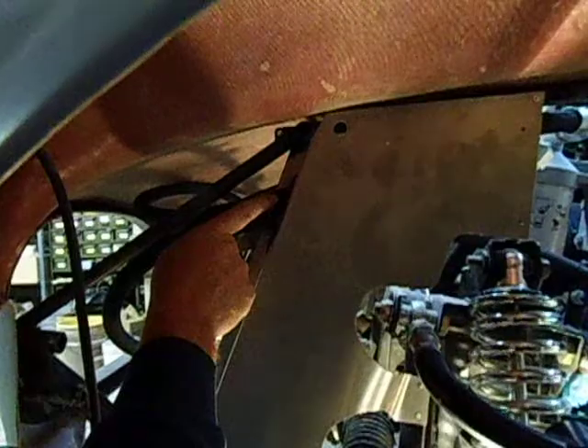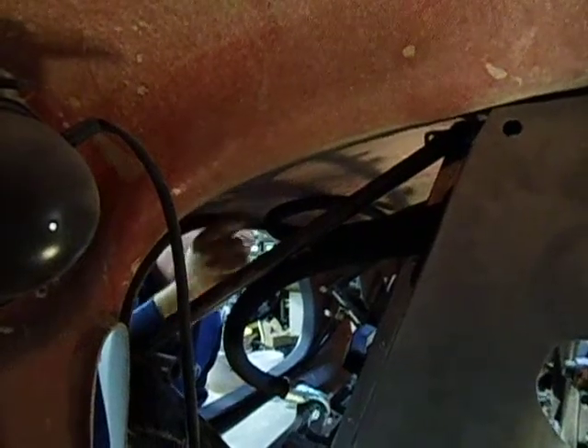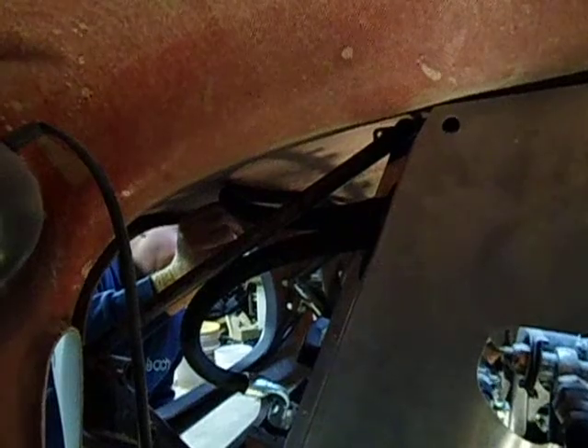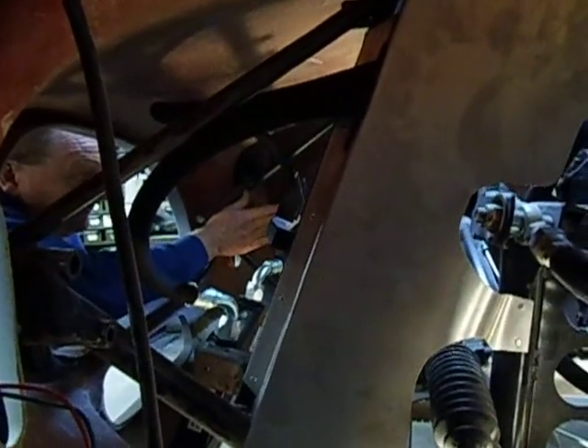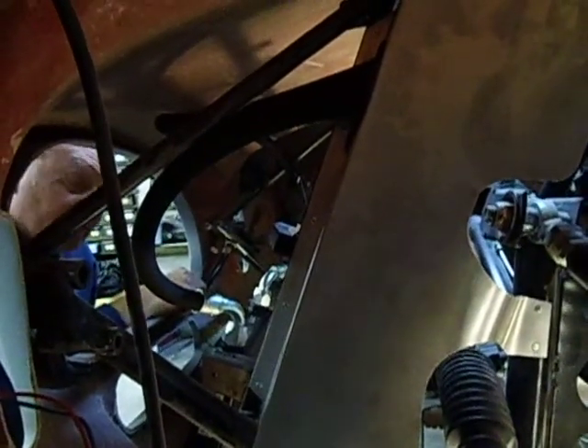I'm going to hop around the front to follow this hose through the top hole or top of the slot. What I typically do is bond a plate in here with a screw so I can use a p-clamp to hold the hose up against the inside of the nose, keeping the routing neat and tidy so it doesn't droop down inside the opening at the front of the car. The oil cooler hose loops nicely around the inside of the nose panel, and over on the passenger side we connect the other end — the 90-degree fitting — directly into our oil cooler.